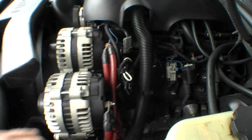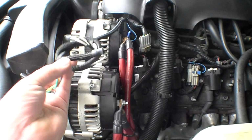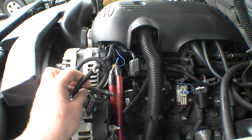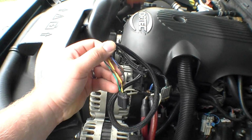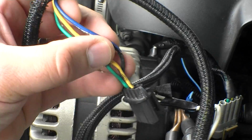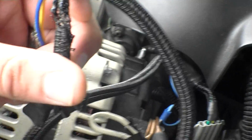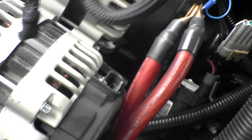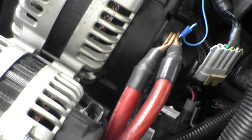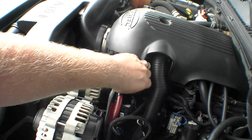Alright, so the last one, first thing, I got the harness a long while back, but one of my alternators was dead, so I only used one plug. Well, I got some new alternators and I went to plug it up. As soon as I started my truck, you can see how these all have crap all over them from this thing melting. This braided jacket here caught on fire, but this wire that's tucked away, it's the actual one that started to burn up. So Mechman sent me a new one to try out. Hopefully there was just something wrong with this harness.